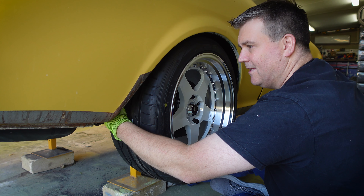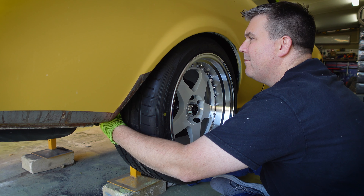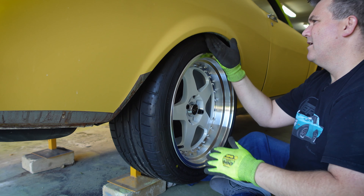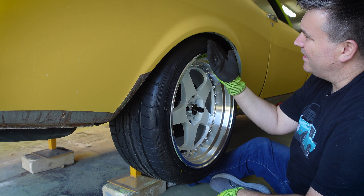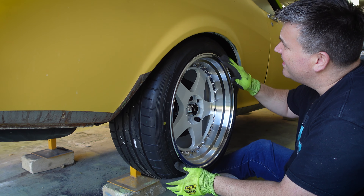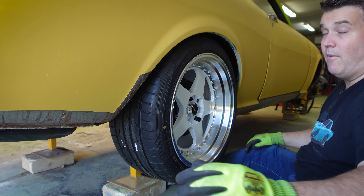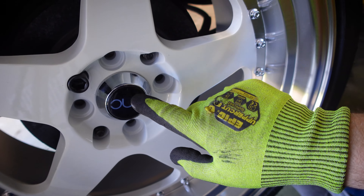There's a lot of backlash on that diff — it probably needs an LSD center anyway. On the other side we have plenty of room in terms of offset, and it's actually a little closer on this side. To lower it further, the panhard rod may not even be required. But I really do think I'm going to have to cut the lip on this fender.